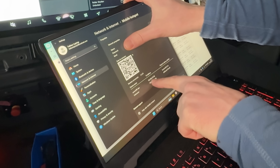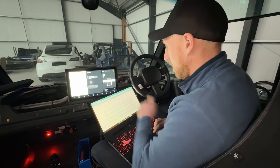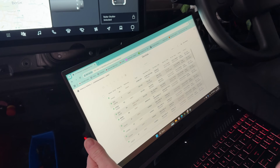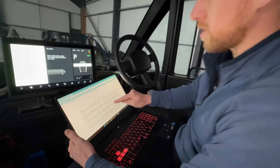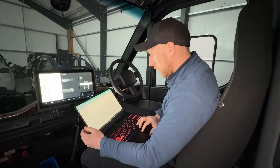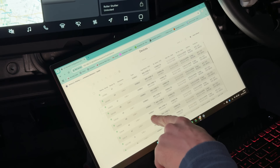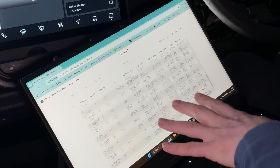I now need to log into that over the web browser, which brings this up because you've got to go to port 8080 workspace. And this is the Arrival software, which is interesting because basically all of this is kept on a web browser on that comms module up there. You don't have to have a PCAN tool or any of that stuff — you can literally jump on it from a web browser to do any work on the vehicle. In here I've got basically data on every single module — every single battery module, there's 18 battery modules, every MCU, every IO module.